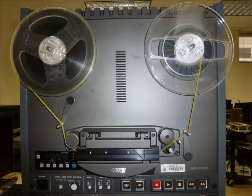If you choose to rewind the tape, thread the tape back through the heads in the opposite direction and thread it onto the left reel. The tape should look exactly as it did when threading it before digitization, only the reel on right is full now and the left empty. Always rewind with the tape spooled through the heads, or the tension will be off between the reels and the tape will likely snap during rewind.